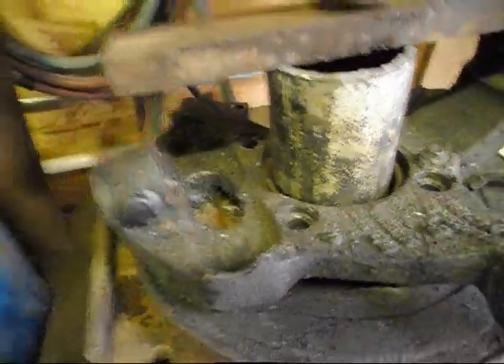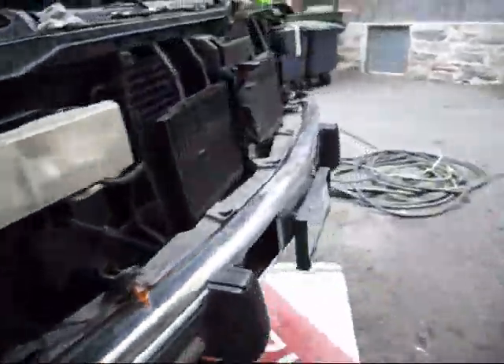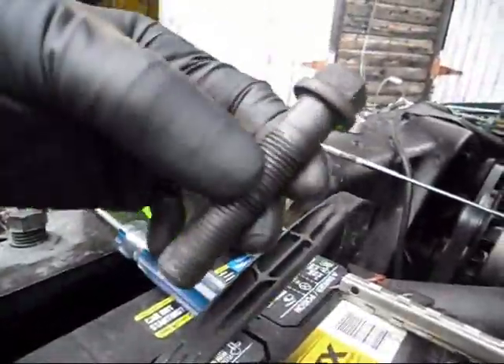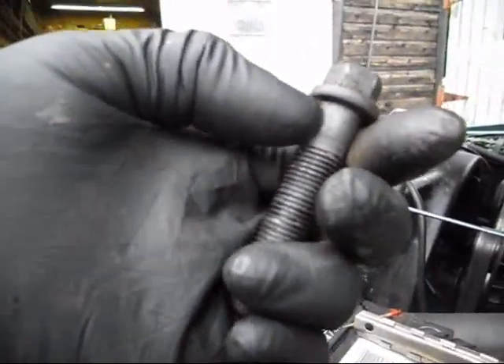Couldn't have been easier. Everybody kept saying just hammer on the bolts — I'm not hammering on the bolts. One guy brought his bearing assembly into the machine shop after he had destroyed it, and the bolts were Torx bolts and he'd beaten the crap out of them. They're not Torx bolts — they're just hex head 15 millimeter with a little expanded area just below the washer head.